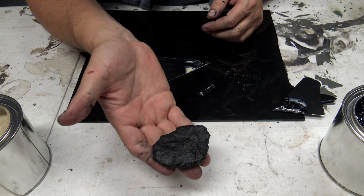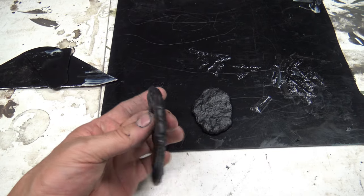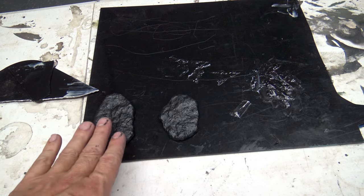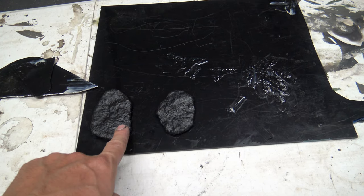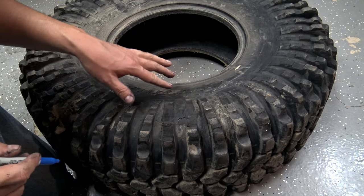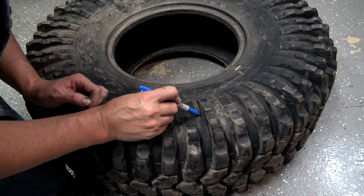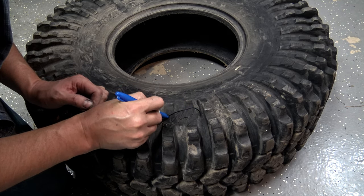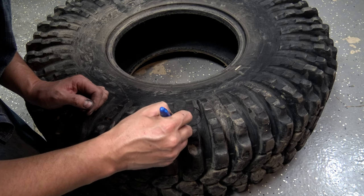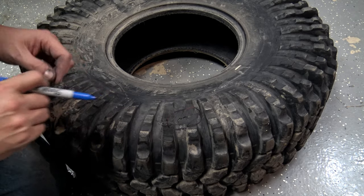I'm going to make the second one a little bigger. I'll just make it and have it ready. I've got one about that thick, one about that thick, and we're supposed to let these sit for 30 minutes to cure before we put them in the tire. So while I'm letting this cure, I'm going to be grinding the tire out. The instructions say to clean this as best you can even before you grind it, inside and out, and you want to go an inch past the cut. I'm going to draw with a sharpie about an inch past the cut just to give me some reference while I'm grinding.